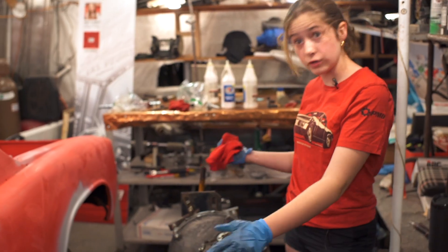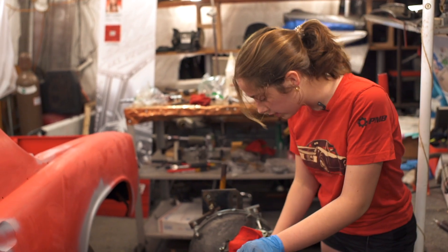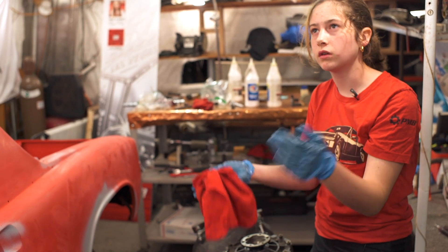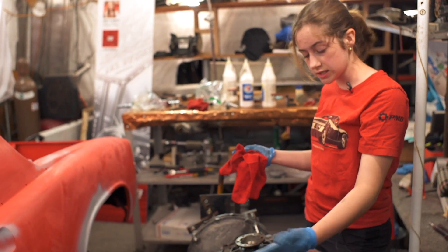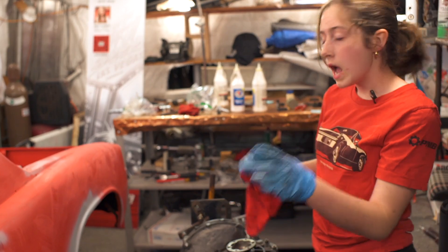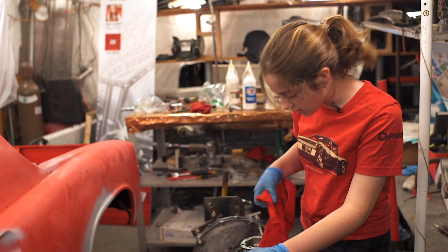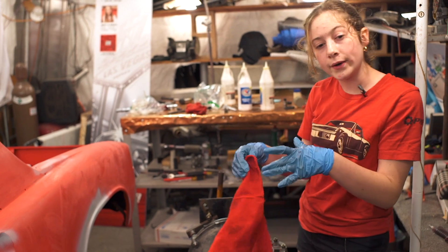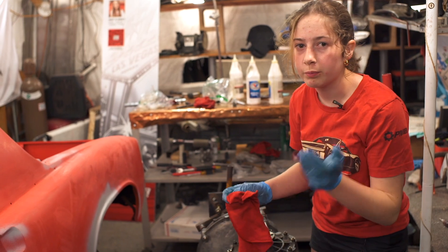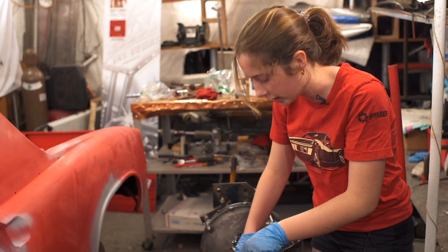You may be thinking why am I using a transaxle if I'm going to turn this car into an EV. The Hyper 9 motor I'm going to put in this runs at about 6,000 RPM, and so does this transmission — it was built for about 6,000 RPM, so they're a great match. Also, when I'm driving down the highway I can just put it into fifth gear and it uses less energy for that same speed, so theoretically I could go farther.